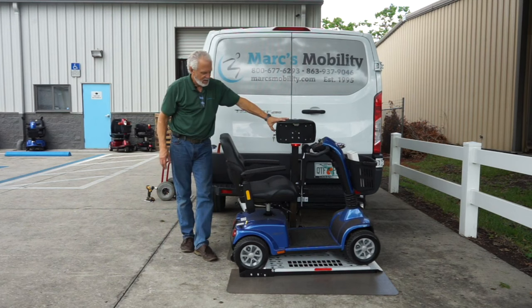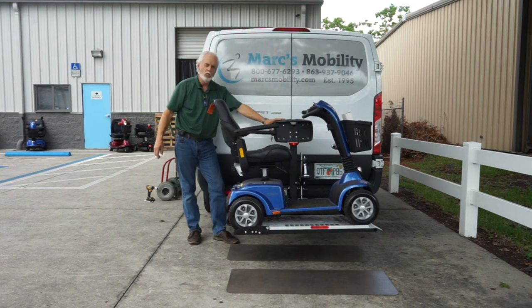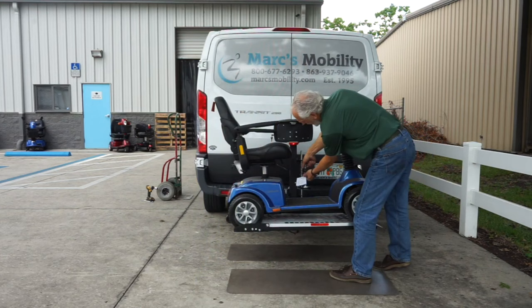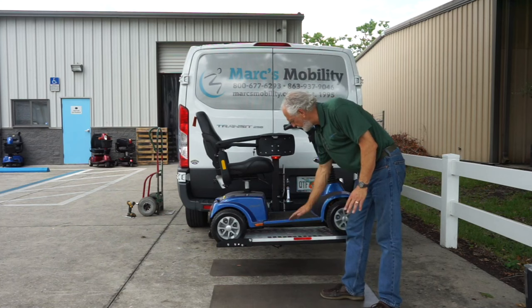It's going to tip down but it'll come back at an angle in a second. This arm right here will lock your scooter. The only thing you'll need to adjust is the arm — there are two screws here that you can see are loose, and this can be adjusted up and down. We don't want the arm to be too tight or pushing through the floorboard; we want it to push hard but not through the floorboard. If it's a small scooter you might have to let it out more; if it's a taller scooter, you might have to let it up so there's not as much pressure.